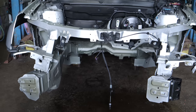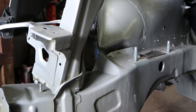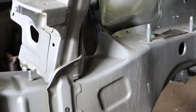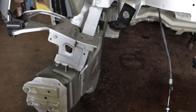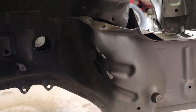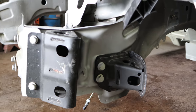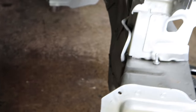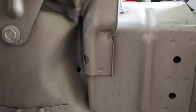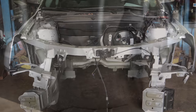Now that the motor is out, we can take a better look. That frame rail has a pretty good kink right there — there's the back side. This one's got a pretty good kink too, and this one's also pushed in. The car that hit it hit right on this rail, so it went over and in. The other rail just kind of went over — the reinforcement pushed it over. The upper radiator support really didn't move all that much; it moved with the aprons a little bit. So when we cut the frame rails off or pull them over and remove the aprons, the upper radiator support will go right back where it belongs without much pulling.